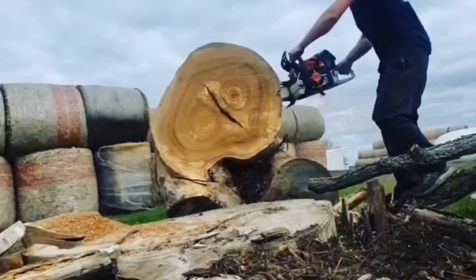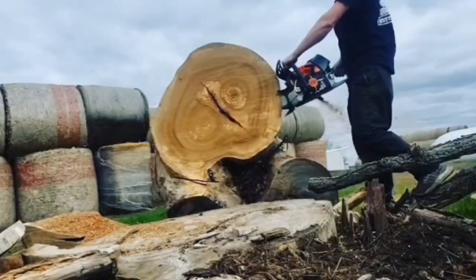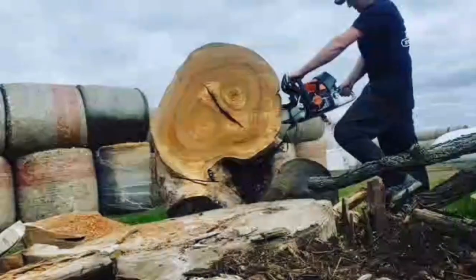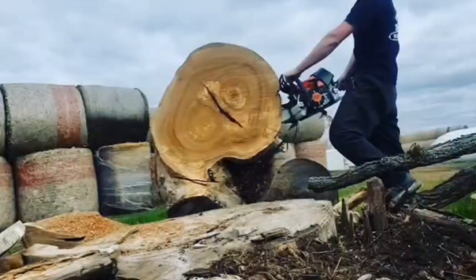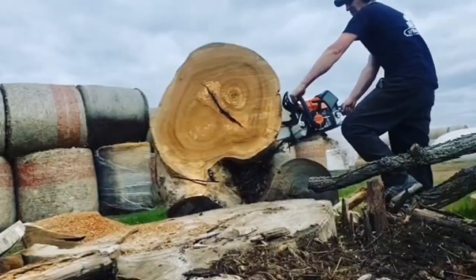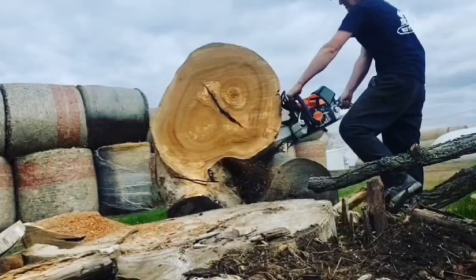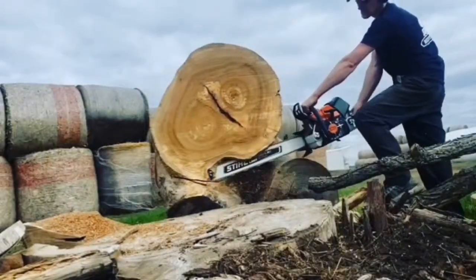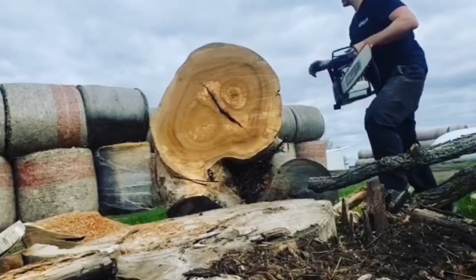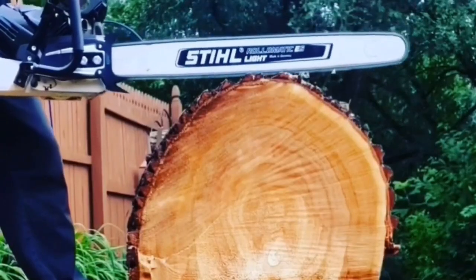With that said, I'm not going to move off of this — it's not even an opinion, it's a fact. You need compression to get good torque to build saws for production guys, loggers, wildfire guys, legit fallers. The 130 psi deal isn't going to cut it — no pun intended — and I'm not trying to hurt anybody's feelings, I'm trying to help.